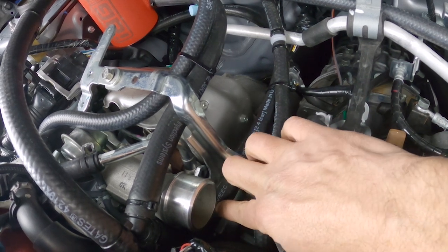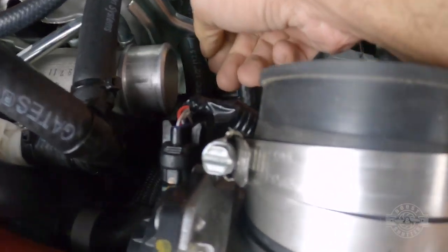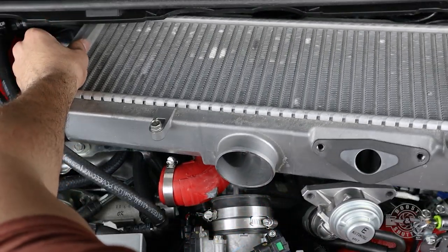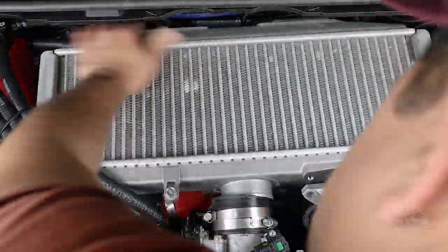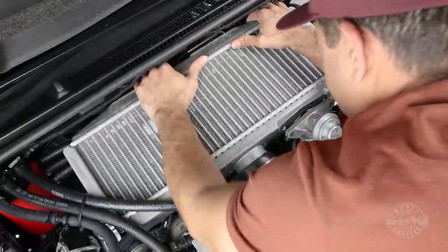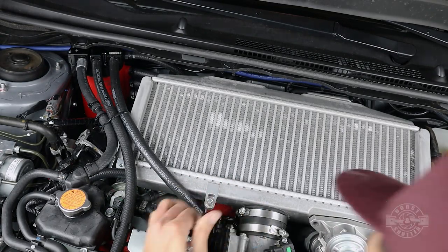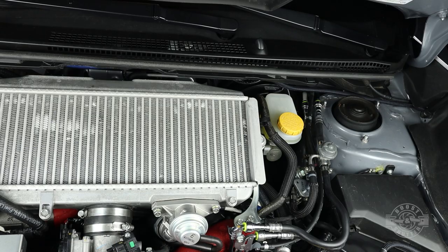Where the intercooler goes in first, if a hose is sitting right against that opening, you'll have a very tough time getting the intercooler in. Simply push the hose through to give you enough clearance around the intake. Grab the intercooler and work it into the inlet below first by wiggling it sideways. Make sure the intercooler is clear of obstructions before it goes in. When the inlet hose is mostly in, start working the outlet above it to fully seat the intercooler, then tighten the two hose clamps to 2.2 foot-pounds.